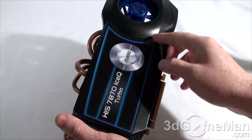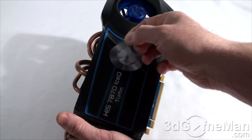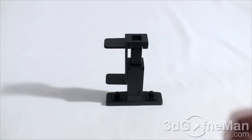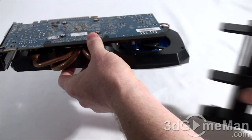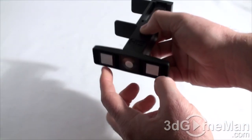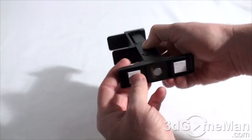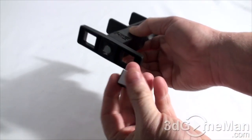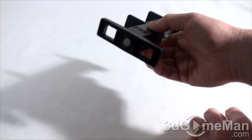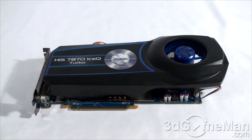The video card also comes with a protective plastic — I'll peel that off now. Let me demonstrate how this support works: you can adjust the height, and when you get the height right you then support the video card with it. The bottom part goes on the bottom of the case, these two pieces pop out, they have a sticky back you peel off, and there's also a magnet at the bottom.